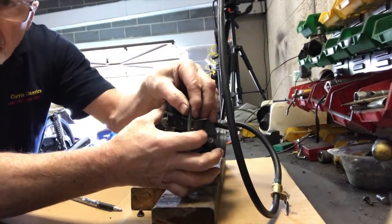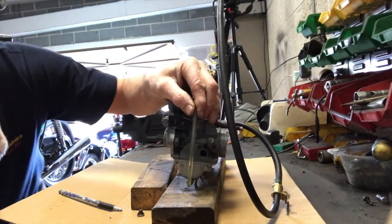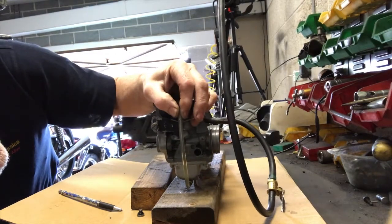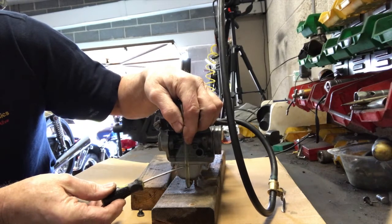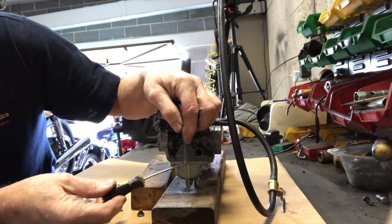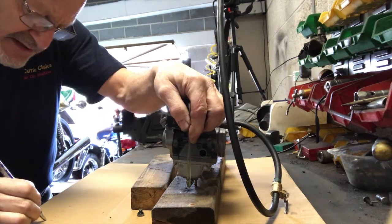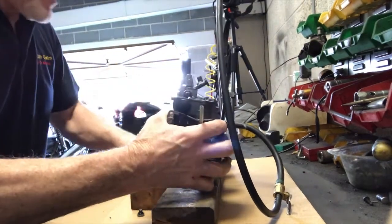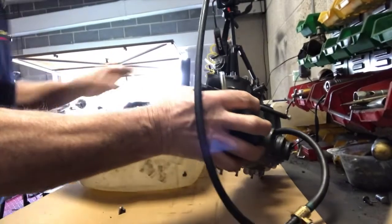The carb's filling now. The mark I've scribed on is right there where my screwdriver tip is. I could be a pedant and say we're a tiny bit high. We've got a leaker — haven't we always got a leaker. Anyway, I told you it was going to get messy. So I'll drain this one now and move on to the next one — turn off the fuel.